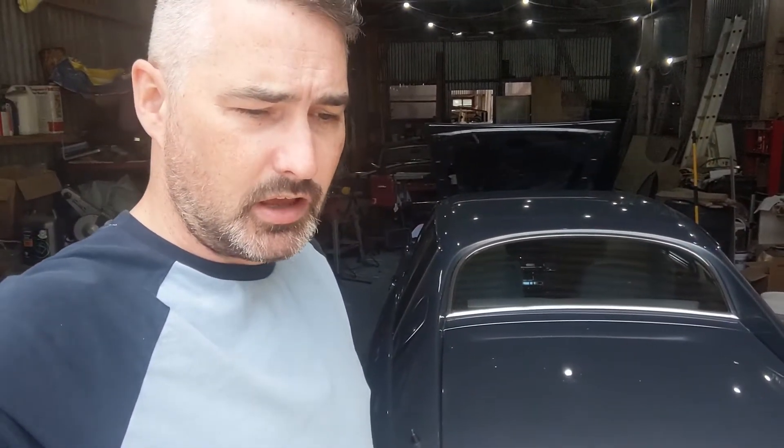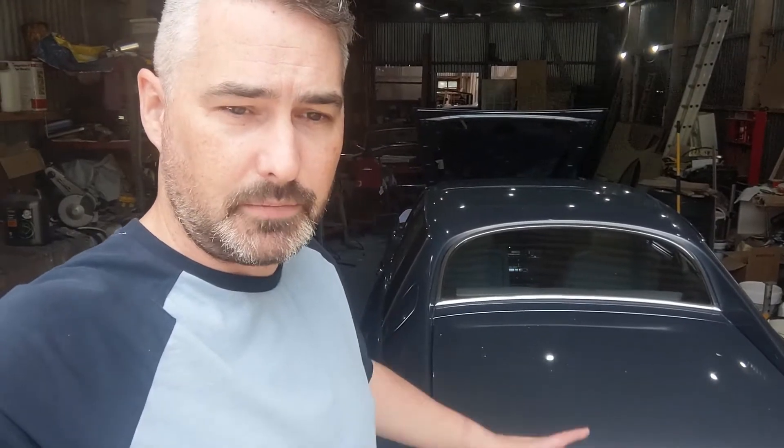I think one of the first things I posted online on a Jaguar forum, the day I got the car, was a question about how heavy the brake pedal should be. It's not really, really heavy but it's heavier than it feels like it ought to be. We've had the independent rear suspension out, changed both rear calipers along with the discs — there was one piston stuck in each caliper — and they were bled properly, but the pedal effort hasn't really changed. I noticed when we did that other job with the car in drive on axle stands that it was almost at the end of the pedal travel before the back wheels stopped turning.